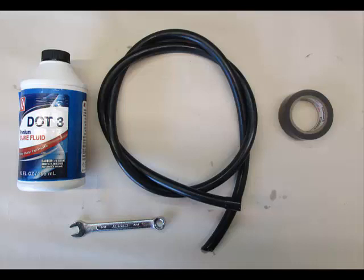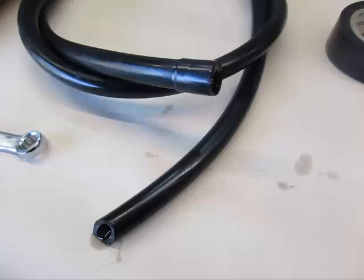For preparations, you will need one can of DOT 3 brake fluid, one five-foot length of quarter-inch rubber hose with tape around one end for a tighter fit at the clutch bleeder screw, and one end cut off at an angle. Also find your 5/16 inch box wrench to loosen the clutch bleeder screw, and find a glass jar you can use as a bleeder container.